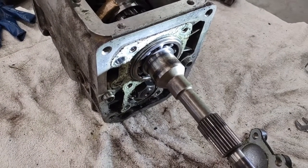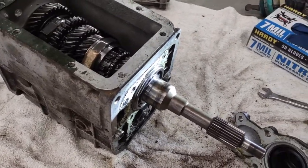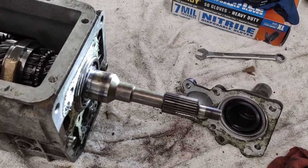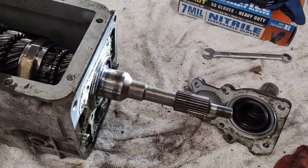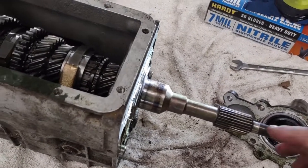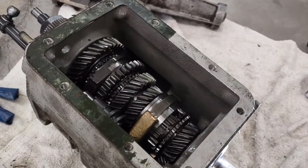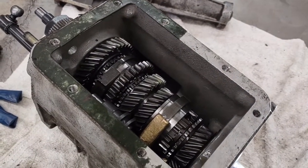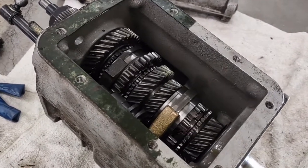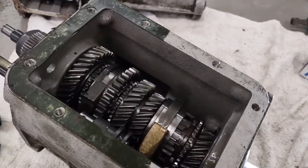That's where we're at with this Lotus five-speed out of a '76 Elite. It drove well except for the vibration. In fourth gear there's no vibration because everything locks together — it's a one-to-one ratio. But in every other gear, they spin independently with a ratio, so that's why you get the vibration more there.